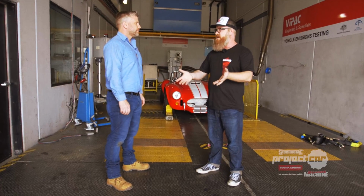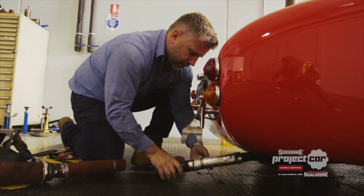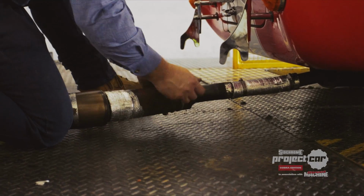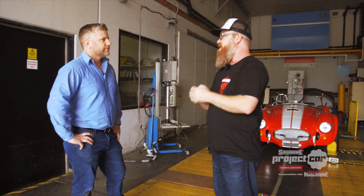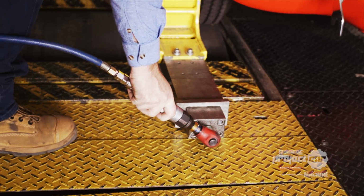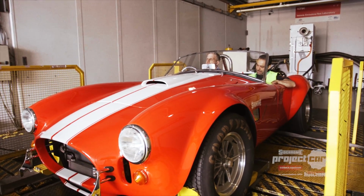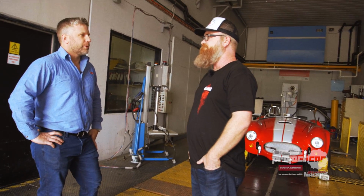All right, so a customer rocks up with their car. I can see we have a dyno here. Once they rock up, where do we go from there? So pretty much we set the car up, we hook up the exhaust pipe to our analysers, and it collects all the exhaust gases and feeds it into our exhaust analysers. I've seen a lot of us are familiar with dynos where you're basically strapping the car down. You guys have got some cool plates and it looks like it's not going to move at all. Well, for this one, it's a two-wheel drive, obviously, so we can just set up the chocks. It's not going anywhere. But with an IM240 test, we're not really testing for power. There's a drive cycle. It basically tells me what speed to go over that 240-second duration. Very cool. All right, we'll check it out. No worries.